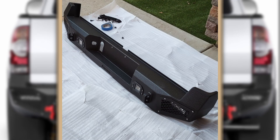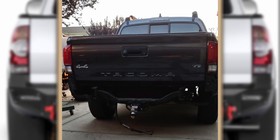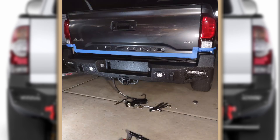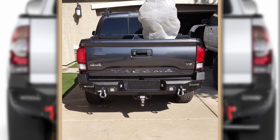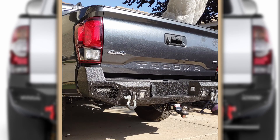Moving on to the rear — the rear bumper was a single piece with multiple reverse lights, D-rings, and just a couple of tabs to mount it up. Once we got the rear bumper off, it was just mounting those tabs and then mounting the bumper to them. However, we did run into a problem: the back of the bumper underneath the tailgate has a little lip that sticks up and when you lower the tailgate they make contact. So I had to trim down that edge and paint it to keep it from rusting. After that, everything fit well — trailer plug fit well and the lines matched up. The front, rear, and nerf bars with that textured finish really complement the looks of this truck.